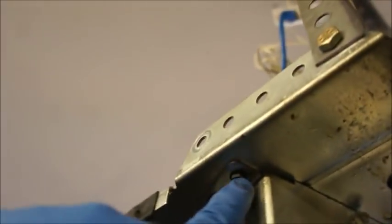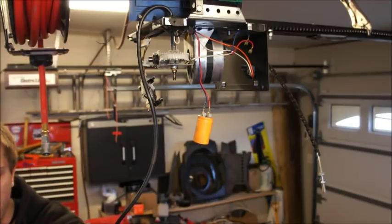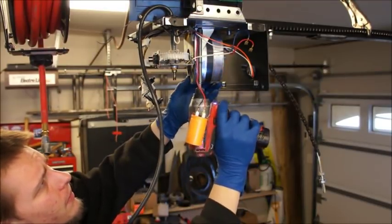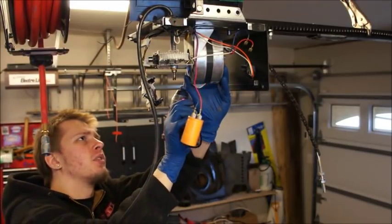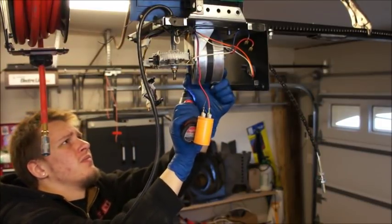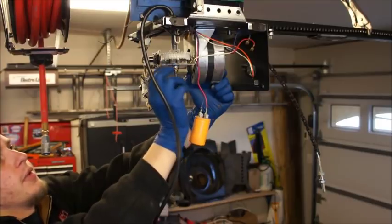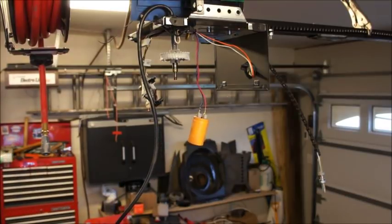Now that you're sure all the wiring is off, you can go ahead and remove the motor. There are two 5/16ths bolts here and two on the other side. Put your 5/16ths bit on whatever driver you're using and remove the screws. Once you pull two out, you're going to want to support the motor at all times. Put your thumb on the bottom of the shaft, pull your fingers here and just pull, and the motor's free.